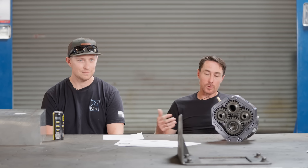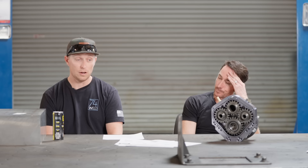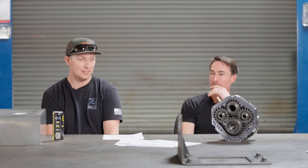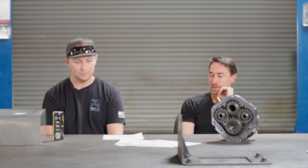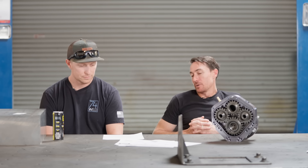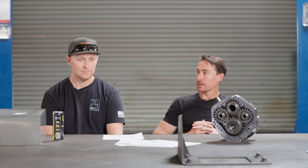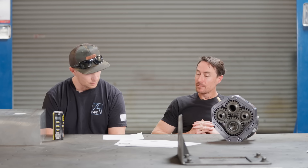What can you do about roll steer? If you're keeping factory-length links — what people call mid-arm — drop brackets are what you need, because a lot of roll steer is a function of the angle the links sit at at ride height. You'd like them to be relatively flat as the suspension cycles. Then guys go to a long arm kit: as you lengthen the arc the angles induced into the suspension decrease and it will ride better.